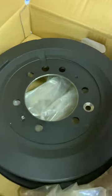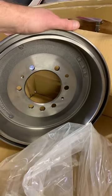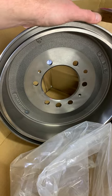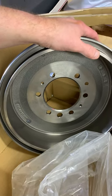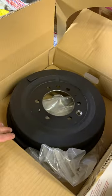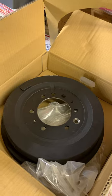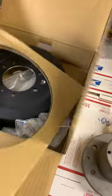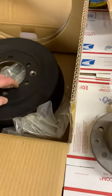They weren't cheap — this whole project has gone over budget, and the brake drums are one of the main reasons. The old drums weren't machinable because of brake drag damage. I did find out why the brakes dragged — the bell crank cable that I showed in my tech video was not seated in the bell crank; it had gotten hung off outside of it.